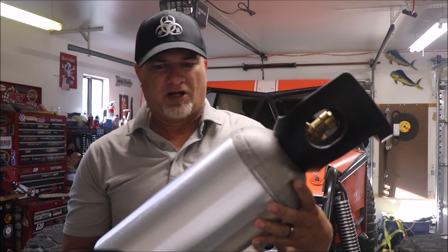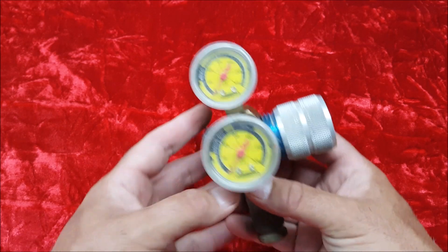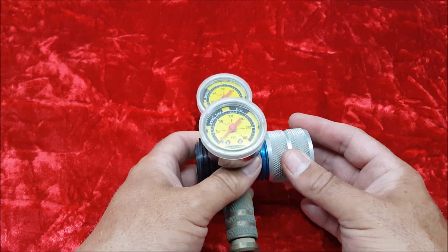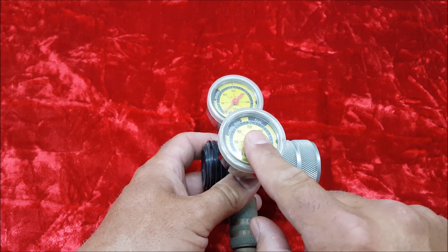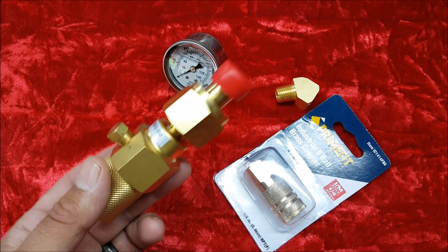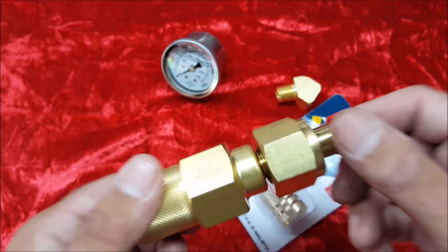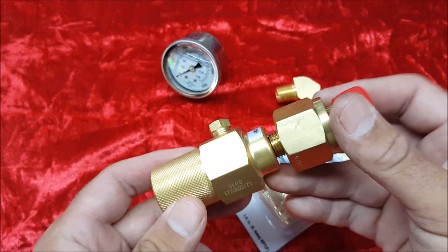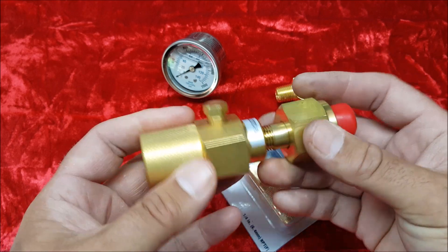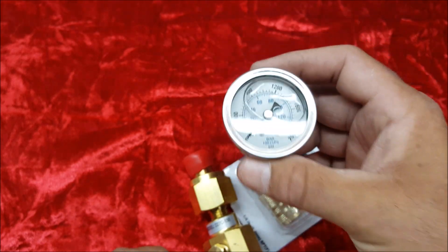Now that you have a recently certified tank with a CGA 320 valve and a handle, it's time to purchase a regulator. Power Tanks come with a really nice dual-gauge regulator, but after 10 years of using them I've concluded they're not really necessary — gauges aren't necessary for CO2 and I never touched the regulator knob after setting it. A simple fixed 150 PSI high-flow regulator is all you'll ever need for filling big off-road tires and running power tools. This regulator can be had for around $40 on eBay or Amazon — it's the same regulator that Poly Performance sells and rebrands. I also added a $15 2000 PSI gauge to verify when the tank is empty.